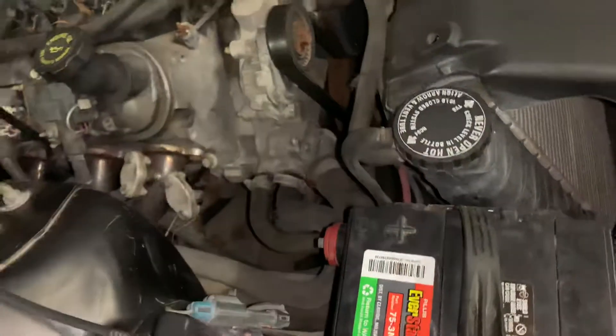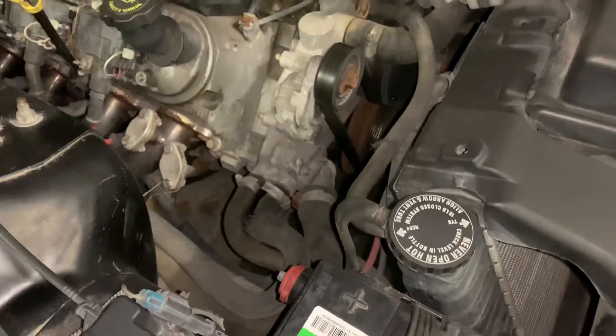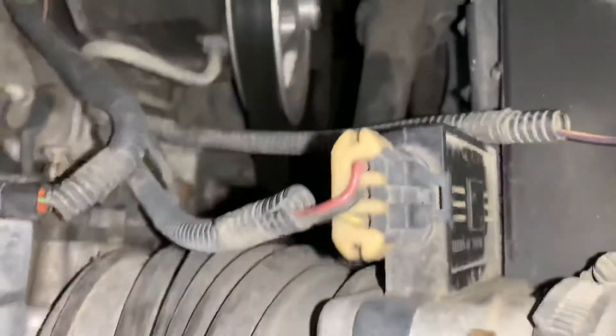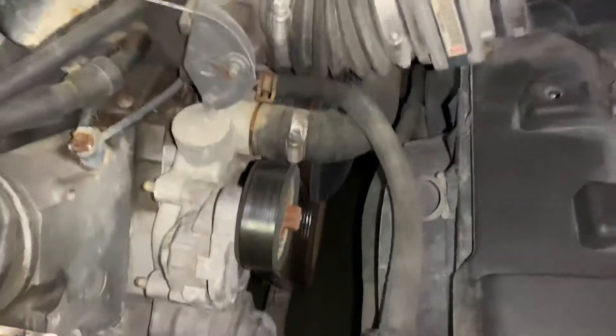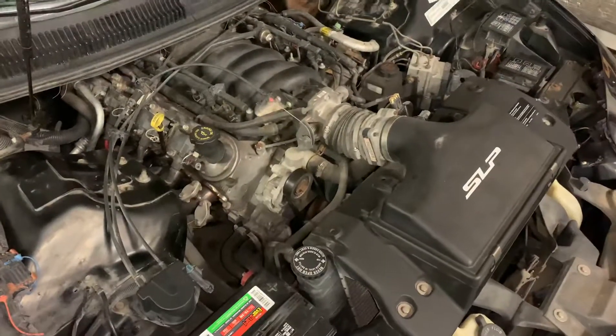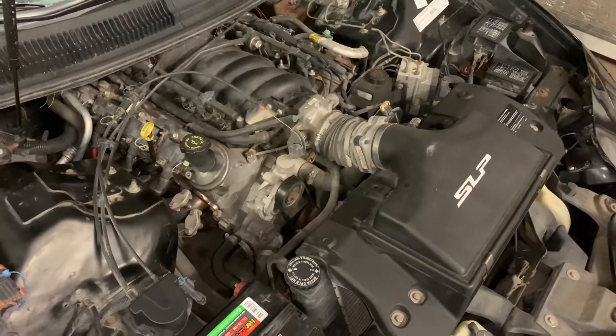If this hose is not strong enough to draw any fluid from the overflow tank, it's going to put the cooling system in a vacuum, or it will compress the tube like this and nothing will flow until the coolant gets hot enough to expand up to its normal operating temperature. Not something you really want on a car you're going to be out racing.